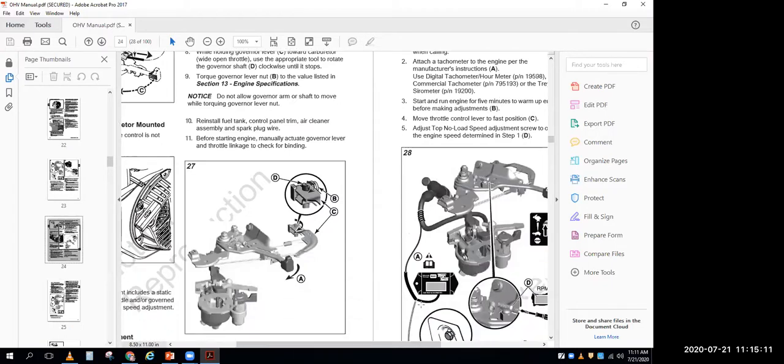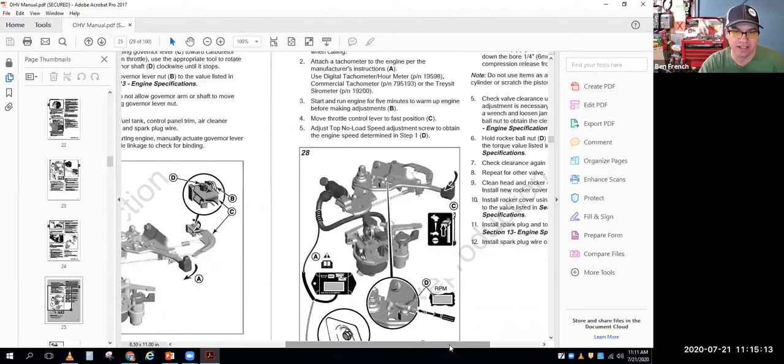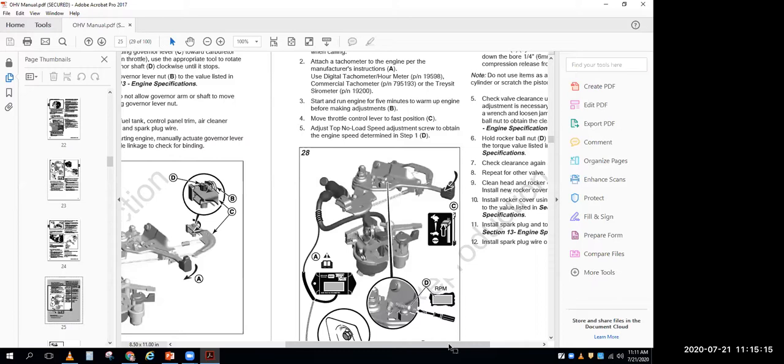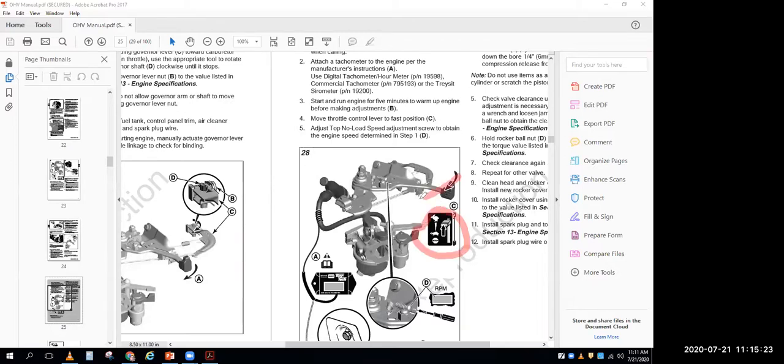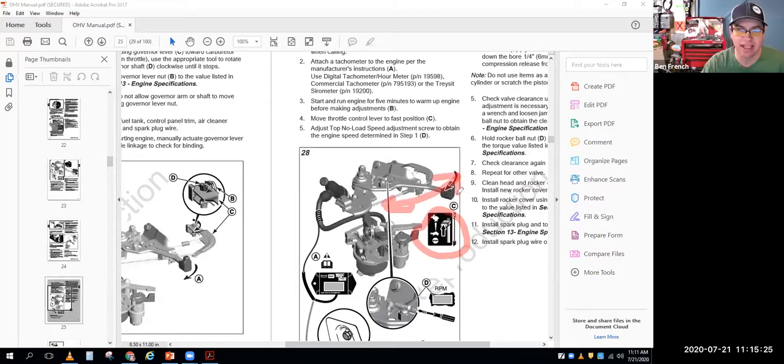You're only going to have a governor on an engine that has a fixed throttle. So like you see in this picture here, I've got the rabbit and the turtle. The throttle doesn't move around a lot. Like I set it to a level, right? I set it to halfway between the rabbit and the turtle, or all the way to the rabbit, whatever. A fixed throttle assembly like that, that's what you're going to find on an engine with a governor.